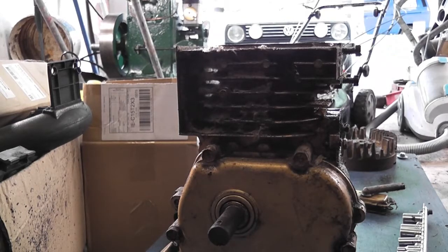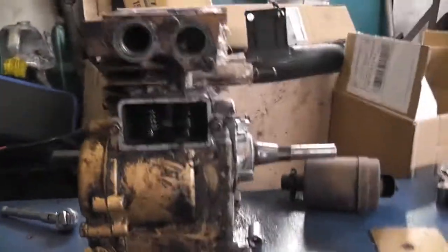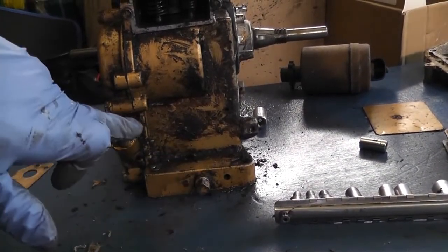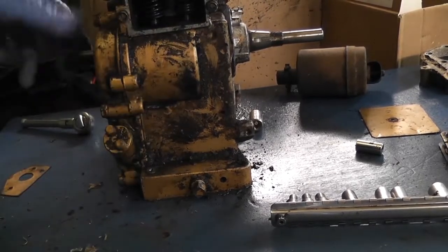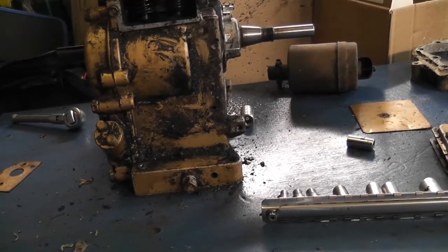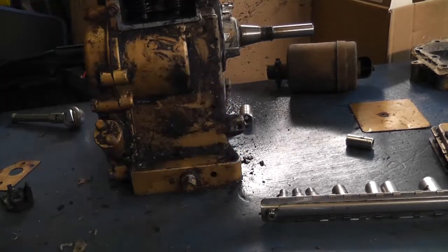The next thing we really need to do is drain the oil out of it. There are a couple of different ways of doing that. You can use this here - the plug for draining the oil - which I think I will use in this instance. Or you can just pour it out the fill. I've screwed this engine down to this piece of wood, so I'll remove the screws first so we can pick it up. I'll crack the drain plug anyway because when it's screwed down it's a much easier operation.